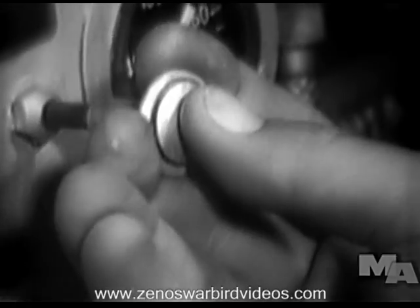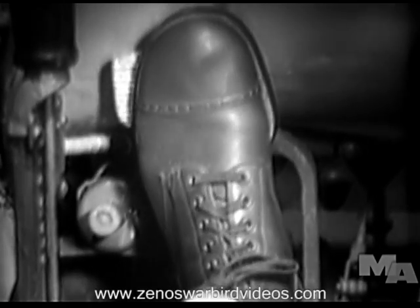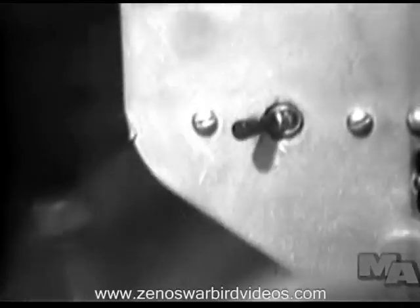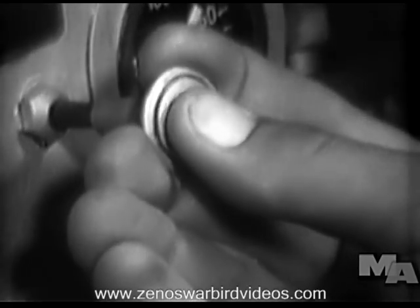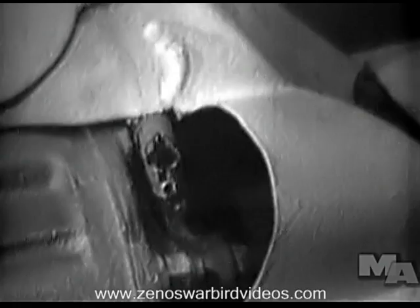The idle adjustment lever is pulled all the way out and the foot accelerator pushed all the way in. As with the gasoline engine, the gear shift has to be in neutral and the clutch must be disengaged. When all this has been done, the starter switch explodes the cartridge, thus starting the engine. When the engine starts, the driver sets the idle adjustment lever to properly warm up the engine at about 1,000 RPM, then checks the instruments and circulation of transmission oil.